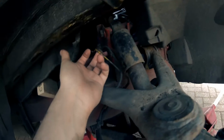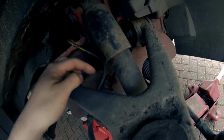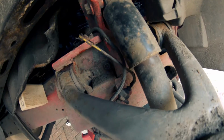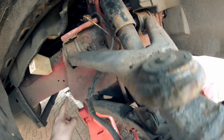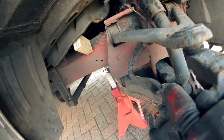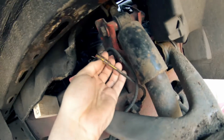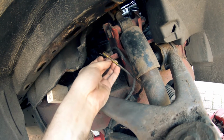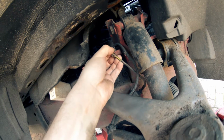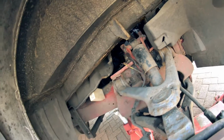There's this guy here. It's not the actual flexi that's gone, there's a connection just there. It's from there and it just goes round, and there's a join just underneath here which I'm going to tap into. So I've just got to replace this section, but you can see that yellow, that's where the MOT guys chalked it. Yeah, that's just all peeling apart, look, so we're going to swap that out.